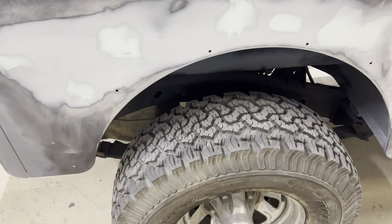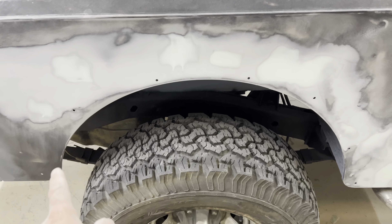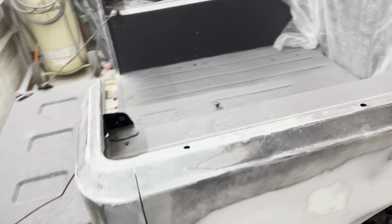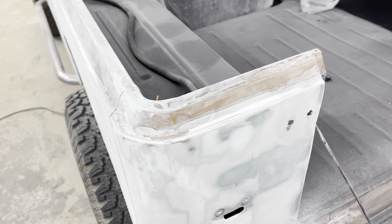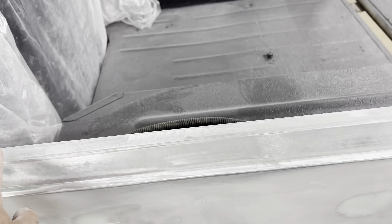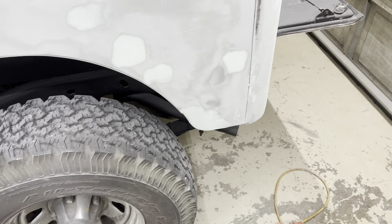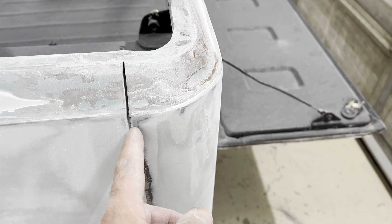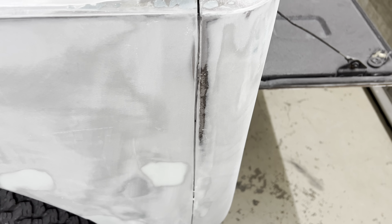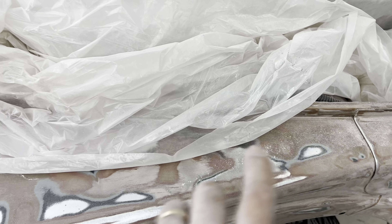I've got to put some self-etching primer in areas that I haven't done yet. Once I put the self-etching primer on, I'm at least going to let it dry overnight before I put the 2K primer on, so I won't get to the 2K primer today. This area, for one thing, was a bare metal rear quarter that I welded in, so there's bare metal here still from that process. Some areas where I got down to the metal — I need to clean that line back out again. I've got some residual glaze down there, and areas with bare metal showing that I don't want to go over with the 2K. I want to go over it with the self-etching primer.